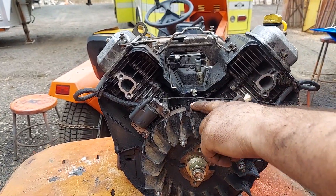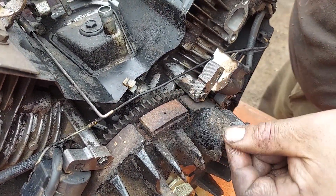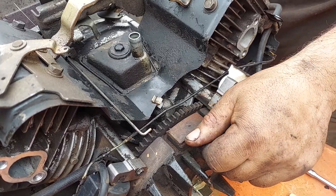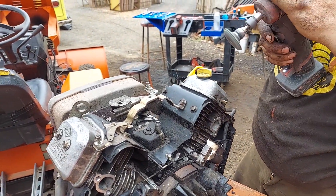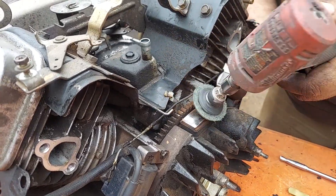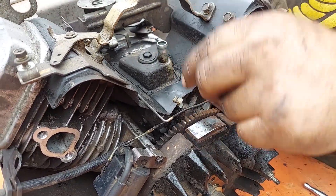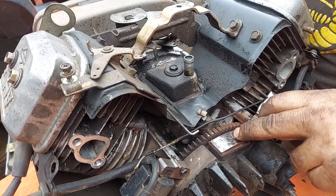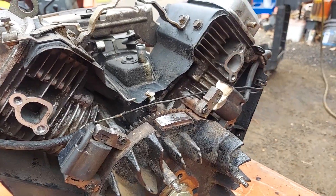You want to be careful but you want to clean this magnet surface up — this one's pretty nasty. It's going to change the magnetic force a little bit, and also change the gap because you have this buildup. You don't want to take the material off, so a little bit of steel wool isn't great because of the magnetic. Sandpaper or a white Scotch pad works good. This should have a good magnetic pull to it — if it doesn't, then you need to replace it. There's a screw on here and you can see it's worn down pretty good, probably because the gap was too close at some point.